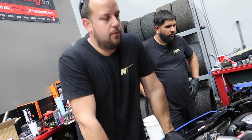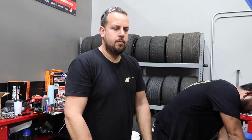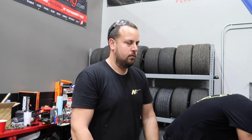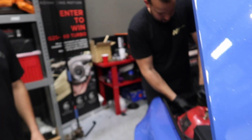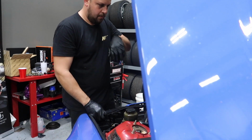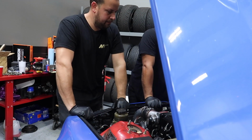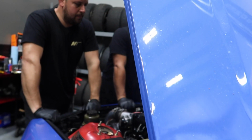So we gotta prime the oil first. Yep. Well, I already have the, what do you call it? The fuel relays unplugged, so. Oh, it is? Yeah. Oh, I just disconnect the crank sensor. Okay, that works too. Right. Prime it. Yep. That sounds good. Yeah. That sounds way healthier than that slow cranking 1J, huh? Instant right there. Let's do it. That's good compression. Oh man. You want another turn? Yep.